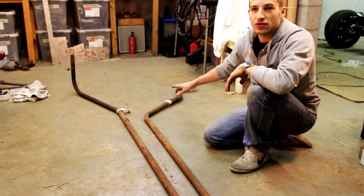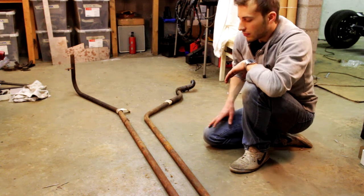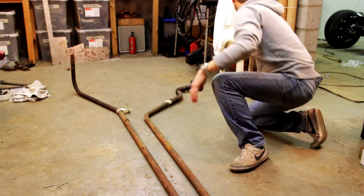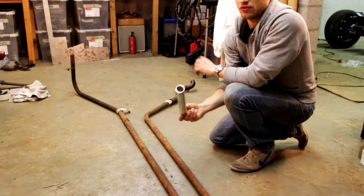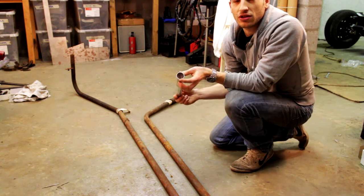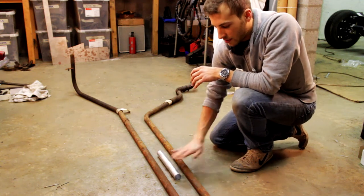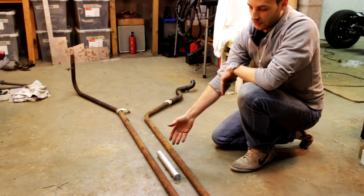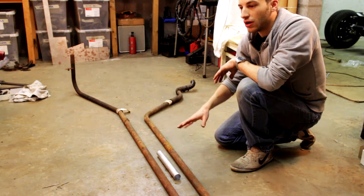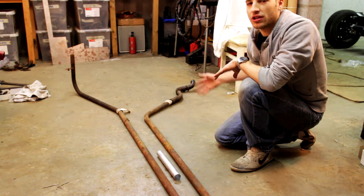You can buy some stainless cooling transfer tubes off the shelf, but I want to make my own out of aluminium. So what I started with was 6 meters of aluminium tubing — 32mm outer diameter with a wall thickness of 1.5mm. It's the same outer diameter as the originals but a lot lighter. I used the originals as a template to know what bends I would need, so I could order up every part and then mock it up.